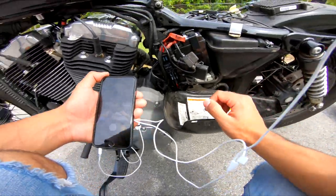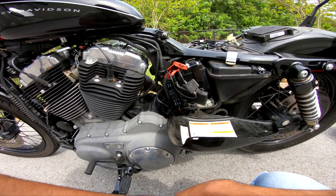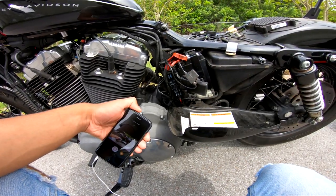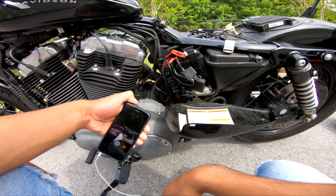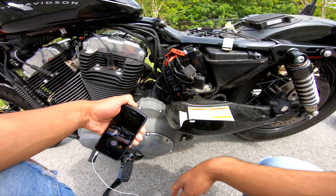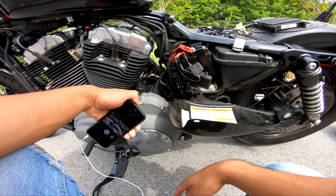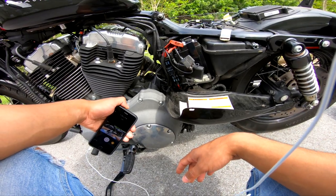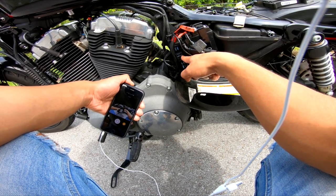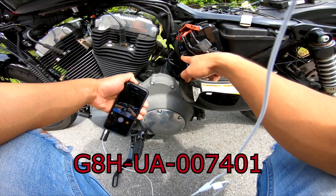The good news is you can apparently get these relays from parts stores — they are relatively inexpensive. I ended up ordering mine off eBay, it took about a few days to get there. I ordered two of them just to have a spare — I highly recommend having a spare. I recommend buying a few of those relays especially because they're pretty cheap, you can pick one up for about five bucks. The OEM one is the Omron brand — that's why I had to go on eBay because I wanted OEM. The model number is G8HUA007401, and it's made in the USA.